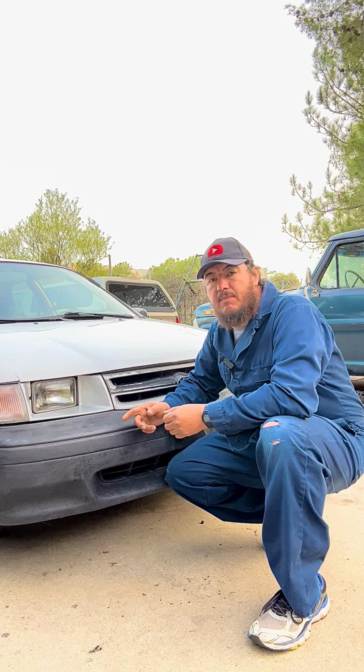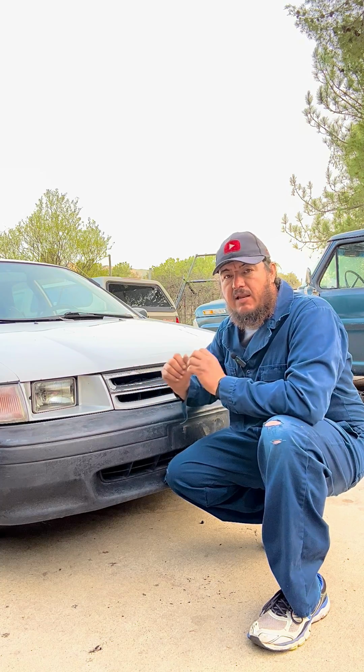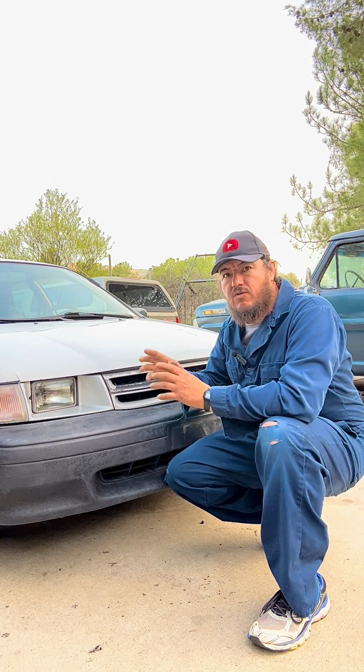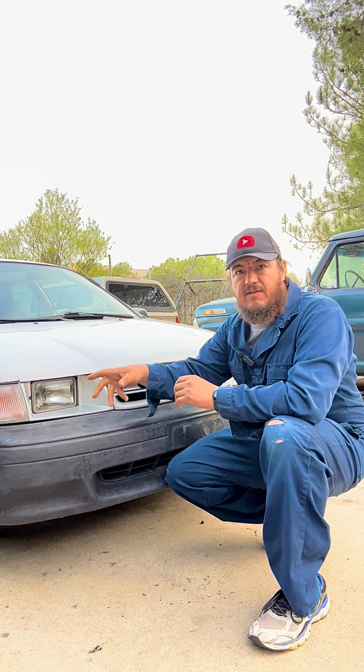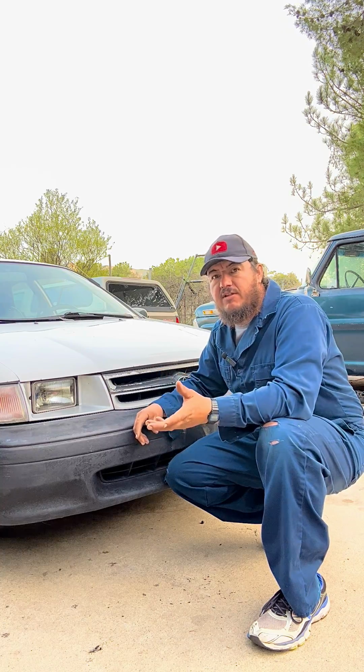Well, folks, hopefully this video was useful on how to replace the rear brake shoes on a 91 to 99 Toyota Tercel or 92 to 99 Toyota Paseo. And one thing about this is that you want to take your time while you're doing this job, so that way everything comes off easy and it goes in easy. So if you don't know how one side is put together, don't take both sides apart, so that way you can have the other side as a reference. Another thing, if you want to replace the bearings, this is when you do it, because you're going to be greasing or ungreasing stuff at this point as well.